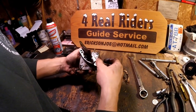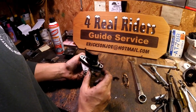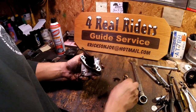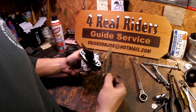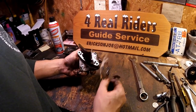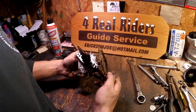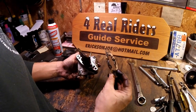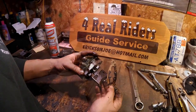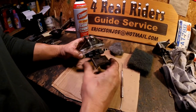Make sure that where you removed your gasket from, there's no debris left behind. If so, take a flat edge razor and smooth that off. Sometimes the gasket will stick to the engine, the cylinder itself, and you may have to pull it off of there and equally check the surface and take a razor blade and clean it. Make sure it's ready for your new gasket. Now we're ready to clean it. I've got a few tools that I like to use for cleaning the exhaust valve.